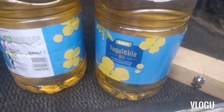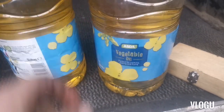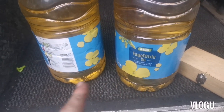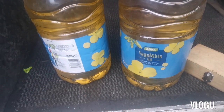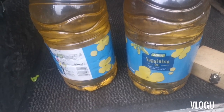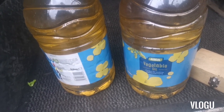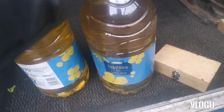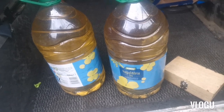Normal vegetable oil — you can use sunflower oil as well, rapeseed oil — it'll run on all of them. Make sure that in the winter you have a better mix of around 50-50. Remember that you can only use 2,500 litres of this a year, so you don't want to go over that.